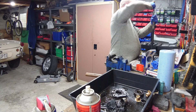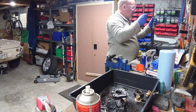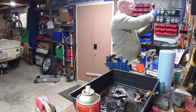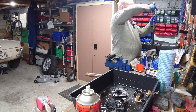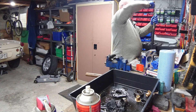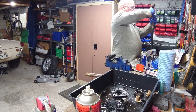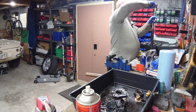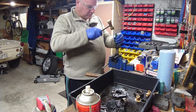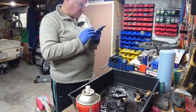A piece of pipe is what's really meant for this job, but I'll just take it slowly. Of note, this stone guard, once it's in place, actually forms the measuring backstop for the rest of the assembly. There's an accurate measurement for the inner lip of this stone guard from the end of the axle — six inches exactly.